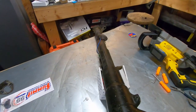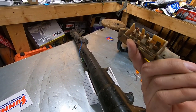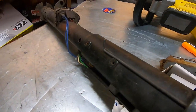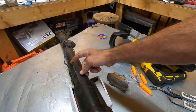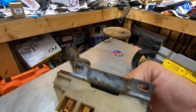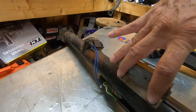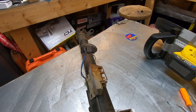Now for your actual ignition switch — your key cylinder actuates this rod right there, so as your key moves, this rod moves. Your ignition has a slot in it where this rod hooks up into. Put that on there, put two bolts in here, tighten it down, and as you turn your key it activates all the positions of your ignition switch.